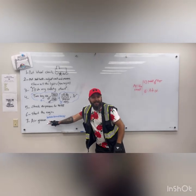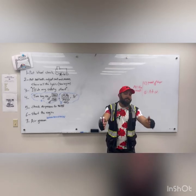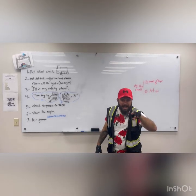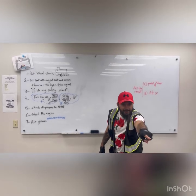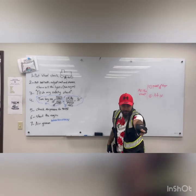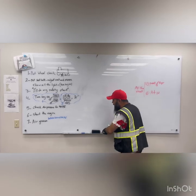For the air governor result: when you hear the air governor cut out, say 'the air governor cut out at 121 PSI, the truck passed the test.' Point with your finger and say 'at' the exact PSI reading. That is number seven complete.